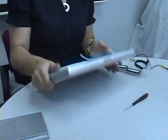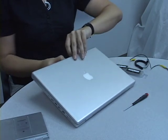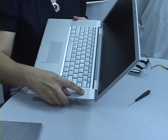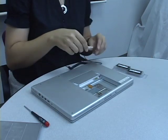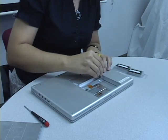Remove the battery from the back of the computer. Discharge all remaining power from the notebook by pressing and holding the power button after the battery has been removed. Ensure you have properly attached the ESD strap to yourself and to any non-painted metal surface of the notebook. In this case, we are putting it in the battery cover.